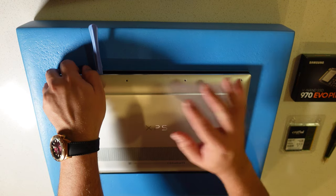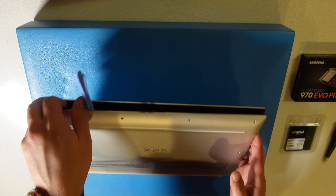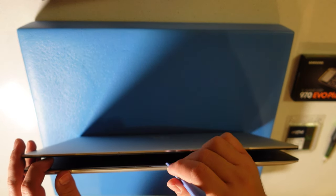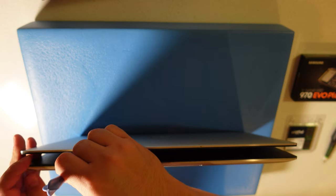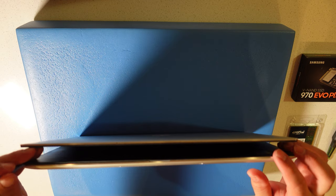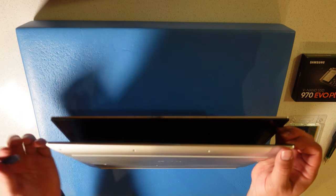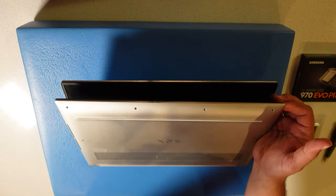Now I'll show you the trick for prying the cover open — it took a few tries, so don't give up. The best starting point is near the power LED. Stick the pry tool into that location and then work slowly along the edge of the laptop. Go around the bezel carefully, and make sure you don't use your fingers as you can cut yourself.